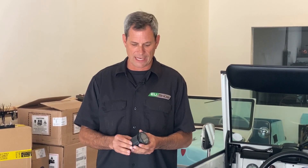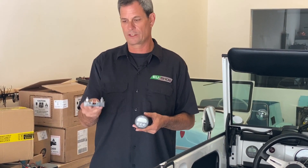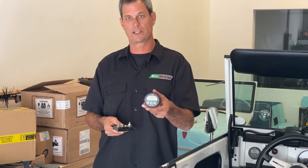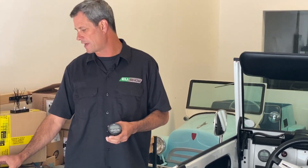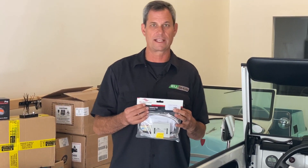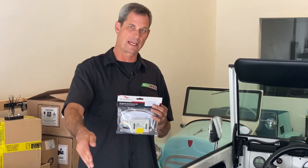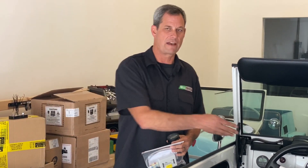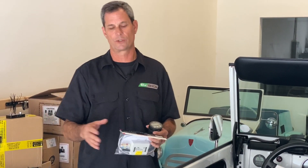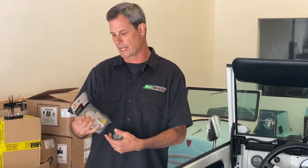It's a pretty simple device. We have the device here — the dash display — installed over here in our vehicle. It really only has one other component, which is a shunt. You're going to install the shunt in your contactor box and install the display up front. Because this is a higher voltage system at 150 volts, we use a 5-to-1 prescaler, which divides the voltage by 5. At 140–150 volts in the back, it breaks that down to about 20-some volts sent to your dash, as opposed to over 100 volts of pack voltage.